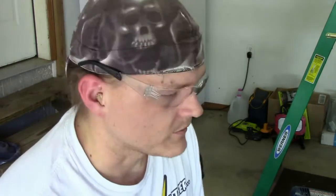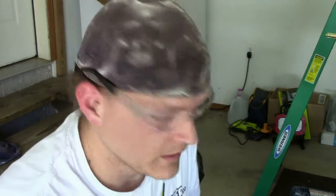And just get it good and clean, a lot better for the solder to stick. You can clean it a little longer than what I just showed you, and ensure that it's really good and clean. They always say cleanliness is next to godliness, so copper loves that. I do brazing at work too with copper, so copper loves cleanliness. It doesn't matter if it's brand spanking new, clean it, because that's the best way to get solder or any kind to stick to it.